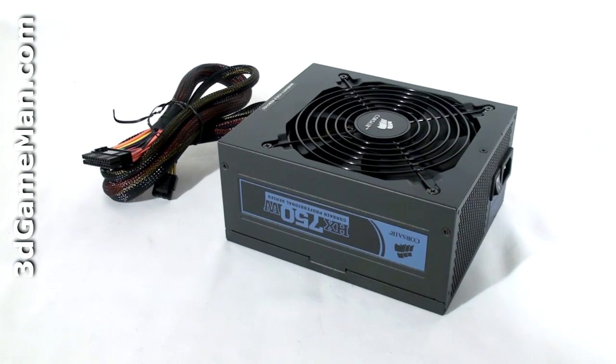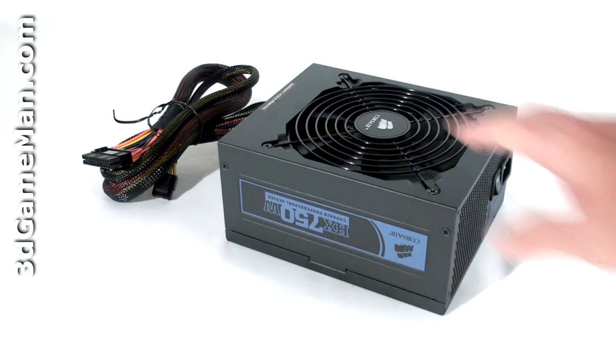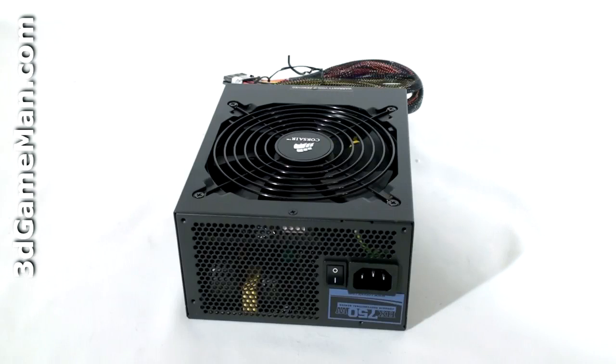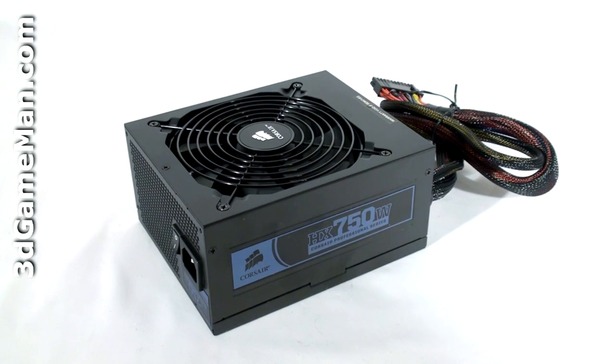Second, it should be at or above 80 percent efficient at typical load. The efficiency of this power supply is rated above 80 percent at max load and around 90 percent efficient at 50 percent load, which is a typical system load. Third, it should meet the latest ATX and other current standards, environmental directives, over-voltage, under-voltage, and other protections — this power supply meets all current standards. Fourth, I'd recommend choosing a power supply that has APFC. Active power factor correction assists the power supply in being more efficient and therefore stable under load. APFC basically reduces total harmonics, corrects input voltage, and allows for full input voltage range — and thankfully, this power supply has APFC.